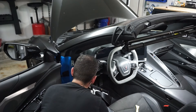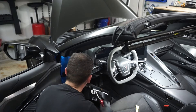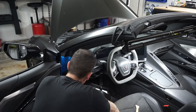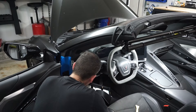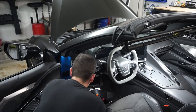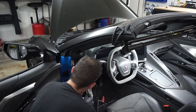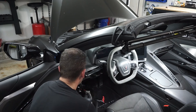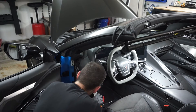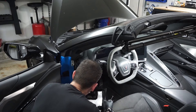Once you have it out, disconnect the electrical connectors — there aren't that many. You've got the heads-up display if you have that, the button for the parking brake, and the dimmer switch. There's a little gray Christmas tree down here — pry that out with a trim tool, then use a hook or screwdriver to disconnect the little electrical connectors. There's a little red tab — pull up on the locking tab and it comes right out. Find the little black tab, push on it, and pull it out.